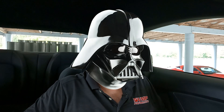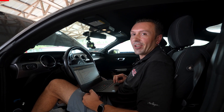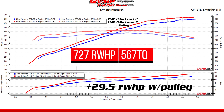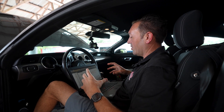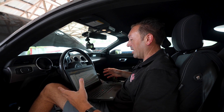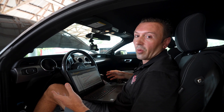Always remember to check your data logs. We made 727 rear wheel horsepower, 567 rear wheel torque. This is really cool — a really nice increase. Odin has been tested all the way up to 1200 rear wheel horsepower, so in this range right here Odin is extremely efficient. It responded very well to a slightly smaller pulley and picked up 30 rear wheel horsepower and 32 rear wheel torque.